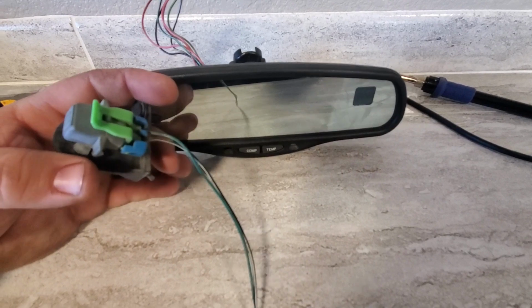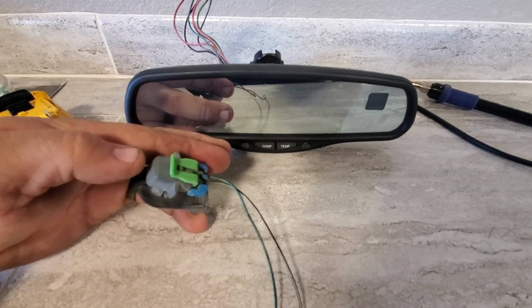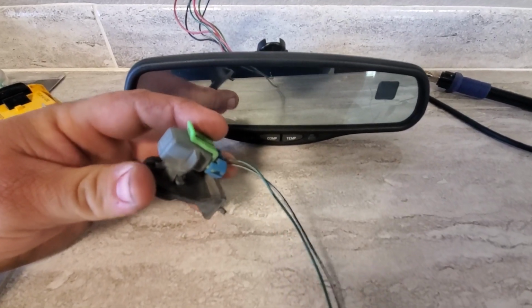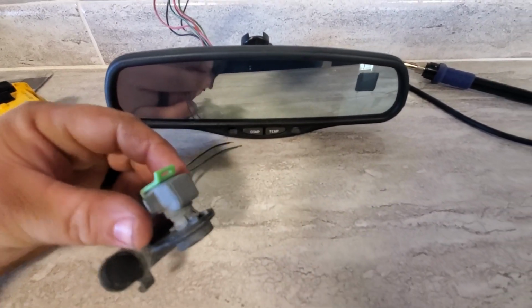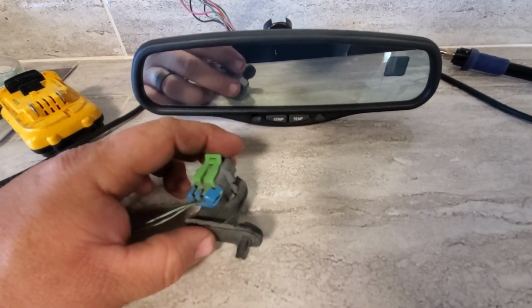I did this mod on my 4Runner. I put this sensor behind the headlight, which causes it to read about 150 degrees when it's 40 degrees out when you're driving slow. It doesn't have enough airflow. So it's pretty critical that you mount it in front of the radiator where there's constant airflow.